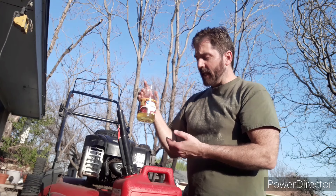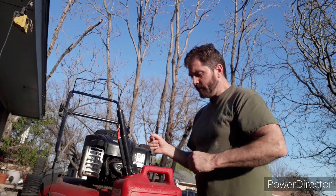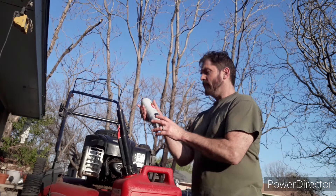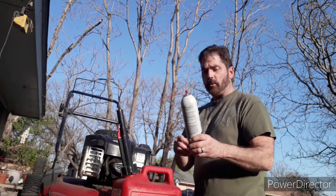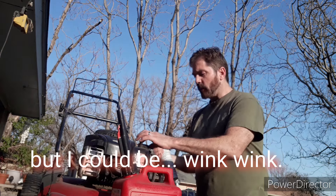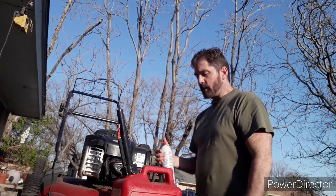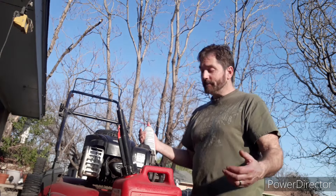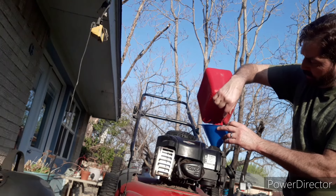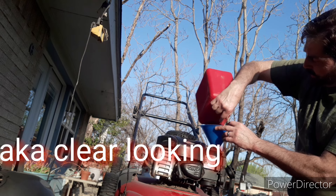I'm afraid that has clogged up the carburetor. So the first thing to do after draining the gasoline: let that dry, put some fresh gasoline in, spray the carburetor out with Gum-Out carb cleaner or any other carb cleaner you have, let it sit a while, put some fresh fuel in there and see what happens. Worst case, it won't start. This fresh gas looks much cleaner and whiter than what I took out.